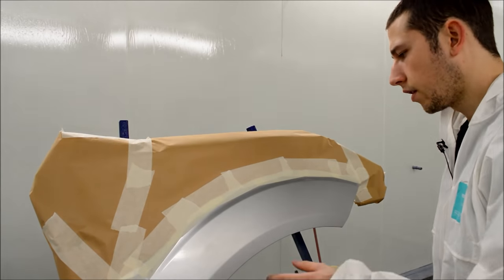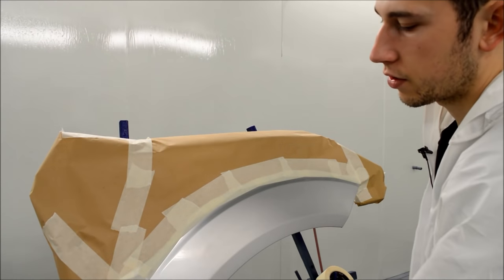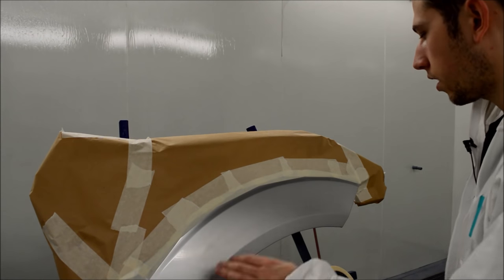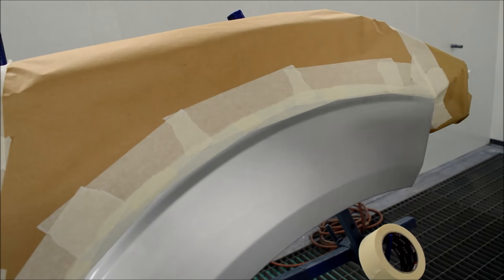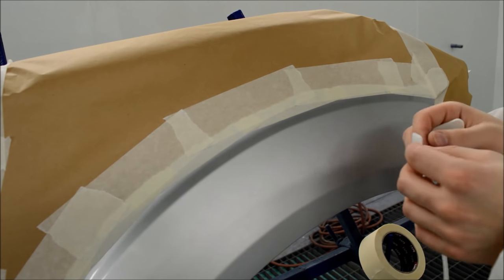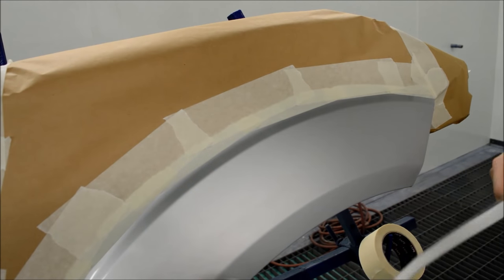We've got our area all masked up and ready to put our J-tape's no-edge blending tape on. All of this area is masked off to protect it from overspray, and I've put a bit of brown paper on the lower edge since we're fading out before we reach it. I've got a zoomed-in shot now of where we're going to apply the J-tape's no-edge blending foam. Each piece is individually wrapped, which keeps it clean and stops it sticking to itself like other foam tapes.